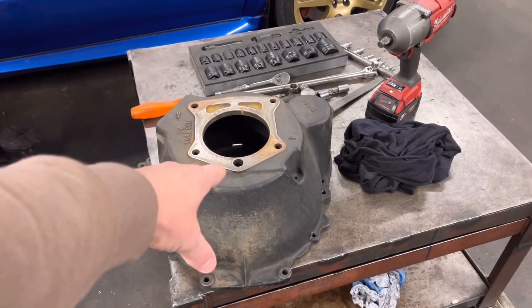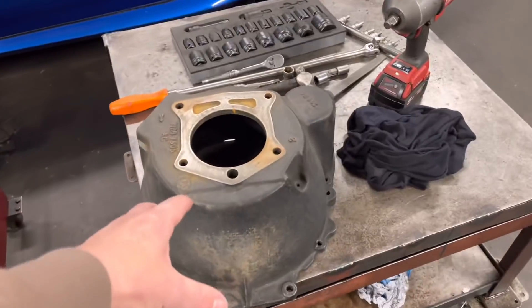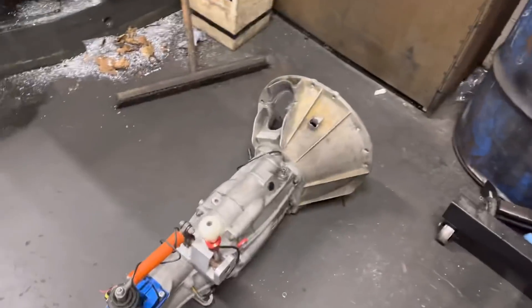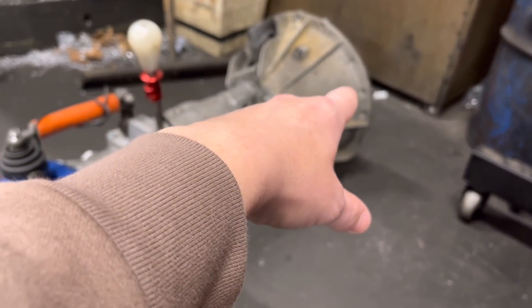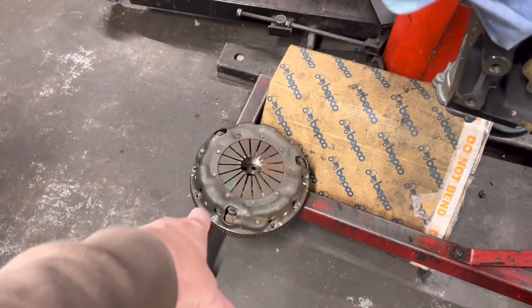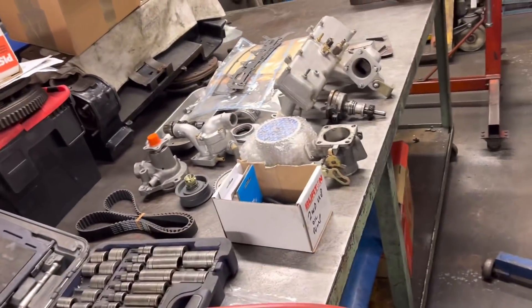The customer's gone and got his own bellhousing - it's a Cortina one, but basically we wanted the Cosworth/Pinto fitment on the front and the Type 9 fitting on the back. The reason for that is the customer has a very nice Quaife sequential gearbox going on it. That original bellhousing comes off and the new one goes on. The shaft out the front is the same spline as an old Cosworth plate I've tried on it. We've used an uprated Cosworth clutch cover, balanced to the flywheel, and we've got an uprated Helix paddle plate.